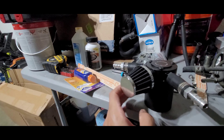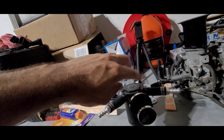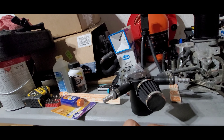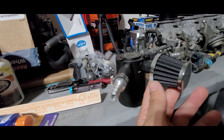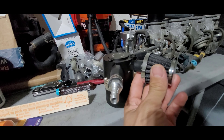I decided to go with the three-port. Both of these ports are inlets — they'll be connected to the PCV valves on the valve cover. The out port would normally go back into the intake manifold, but since I've plugged the intake manifold completely, it's just going to go to atmospheric air. If you run a little filter like this one I got from AutoZone, the engine bay might have a slight oil smell — it doesn't mean it's leaking, it's just the breather letting that odor out from the catch can.